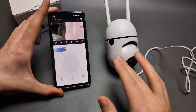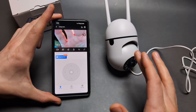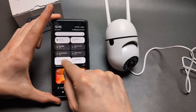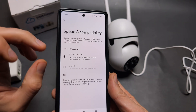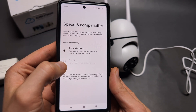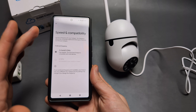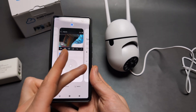Also, if you are running this from Wi-Fi, it sometimes has problems if you're on a 5 GHz network. Some routers only run 5 GHz or 6 GHz and don't have 2.4 GHz, and most problems are due to this. Go into your router or phone hotspot settings and make sure you have 2.4 GHz available.